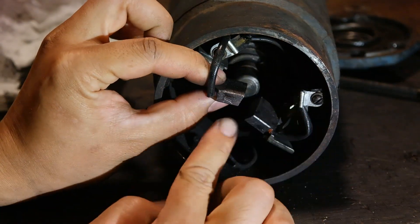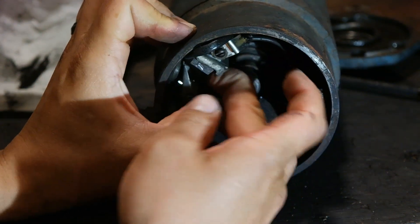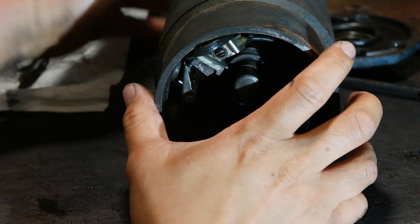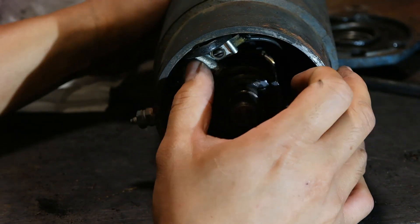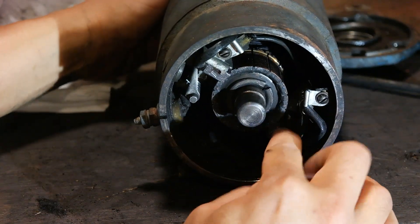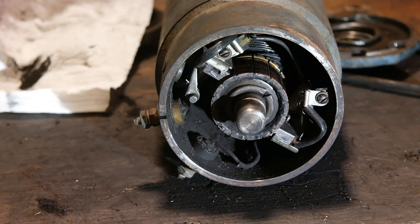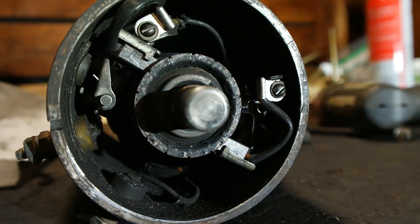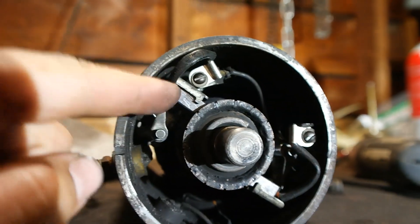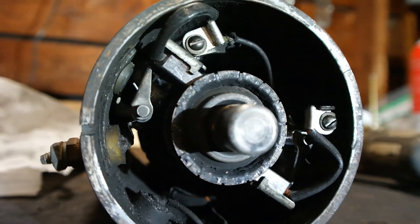To put the brushes in place, you want the angled part of the brush to be the part riding on the commutator. Slide the brush into the little slots and push it all the way back so it almost clicks into place. That way you can slide your rotor through the starter generator and when the commutator is up to the level of the brushes, wiggle the brush in the little spring clip so everything gains tension and falls into place. When done correctly, notice how the angled part of the carbon brushes is riding right along the commutator — that's correct. Make sure they're not sideways or upside down.